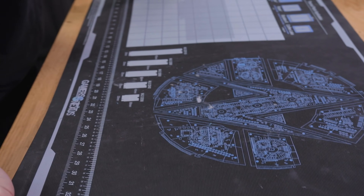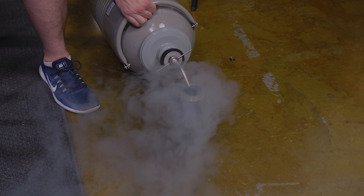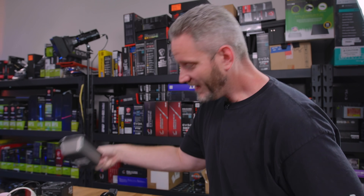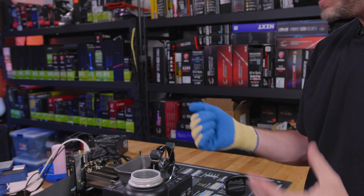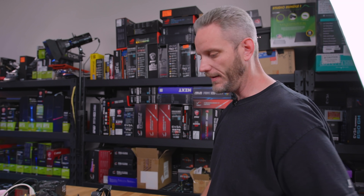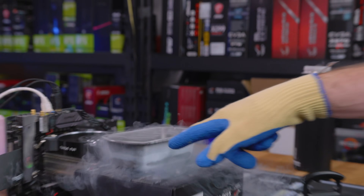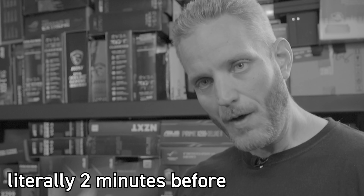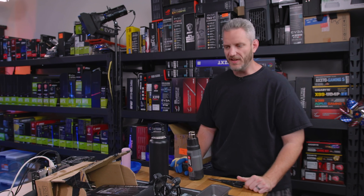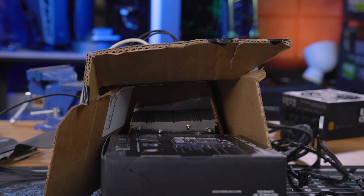Our table is kind of scratched and beat up, so I'm only going to use something I'm willing to get rid of underneath — the Gamers Nexus Mod Mat. This is the scary part: you don't want to use gloves because if LN2 gets poured on the gloves it will burn you more than if it hits your hand, because of the Leidenfrost effect. But if I pour it into this container it's just going to freeze. I'm going to pour bare-handed and handle the frozen container with the rubber glove. Here's V2 of the crap LN2 air-cooled setup — as you can see it's chambered and funneled, so the vapor has no choice but to go down through there. We're trying to catch all the vapors and pull them in.